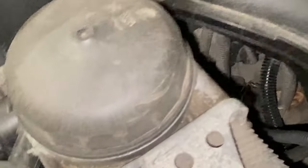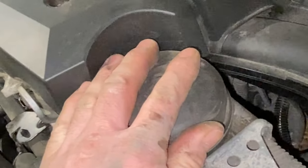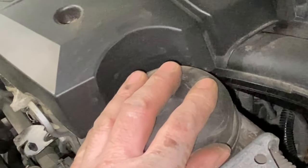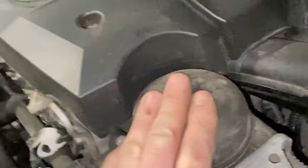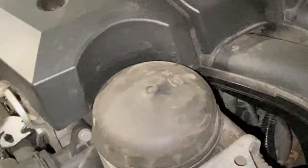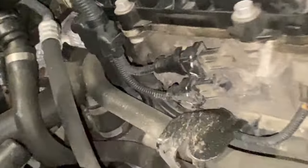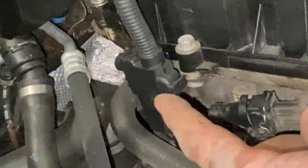On other BMWs, it's on the oil filter housing. And I'll tell you another thing you need to check on these. We'll take it off in a minute. Check these always, because on these, people break them during service and the oil filter cap centerpiece either breaks or sometimes they leave it in the old filter, and you can hear the cavitation noise usually, but that can cause a massive problem with oil pressure and usually affects the Vanos solenoids. There's your Vanos solenoids one and two there. I think the top is exhaust and that's intake, cam sensor one, cam sensor two.